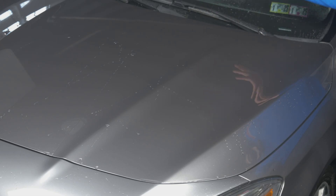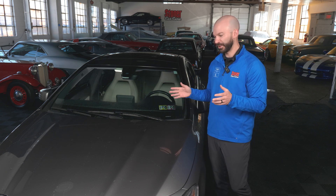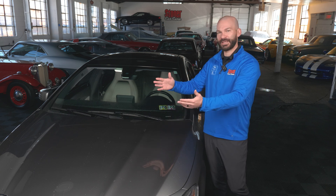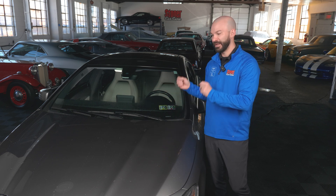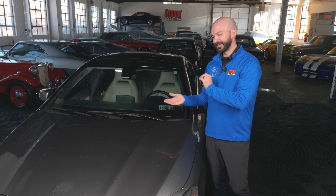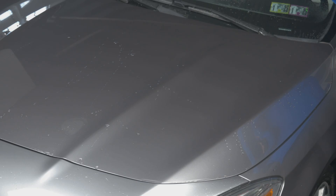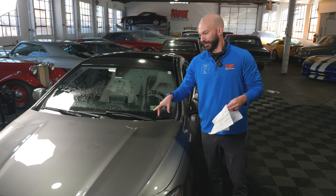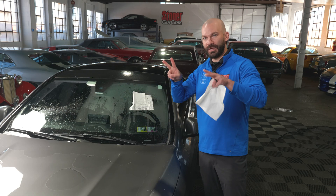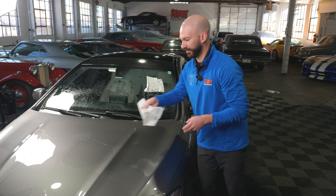The majority of this hood is already dry without any towels or blowing. You're pretty much good to go. The benefit is a lower risk of water spots — that water evacuates, and if there were soils or dirt contaminants, those evacuate as well because the water does not want to be on the surface. The drop angle and bead angle on that coating make it so the water doesn't want to just sit in bead form — it wants to evacuate the hood. When water breaks on a hydrophobic surface, it is completely dry.